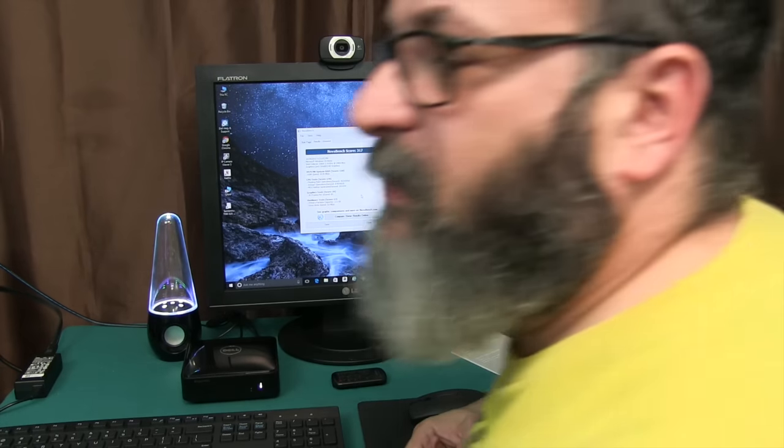The last thing before the upgrades: even though I upgraded it with a similar M.2-style hard drive, you can also squeeze in a 2.5-inch drive — there is space. You can put a full-size solid state 2.5-inch drive in there, which would really improve the speed of the machine. You'd need a special ribbon cable and a slight mod; I've provided a link to an article on ATXGeek in the description box where they did a full teardown and figured out the ribbon cable solution.